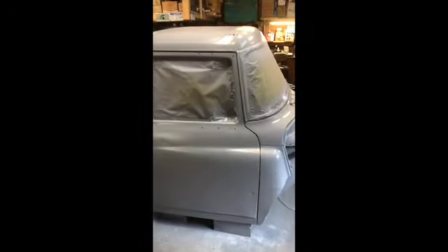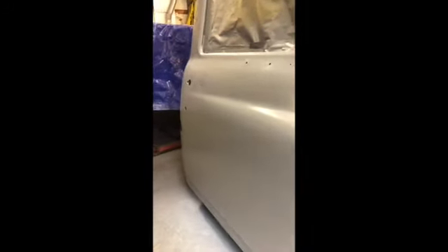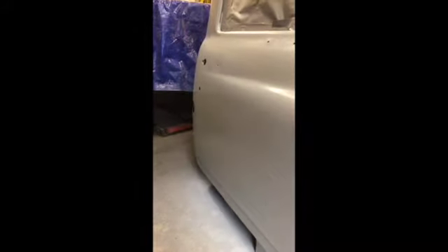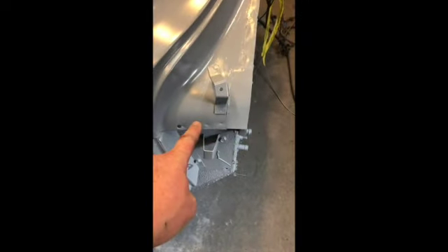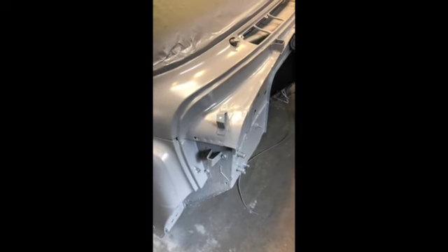Honestly, the bodywork came out far better than I expected. The only imperfections really are some dents I didn't fix perfectly where the mirror brackets go — but there will obviously be mirrors there. The door handle area will have the door handle back on. There are a couple of sags inside the cowl that I didn't fix, because I didn't even body work those welds — I just ground them down. Since it's inside the cowl I'm not going to worry that much about it.